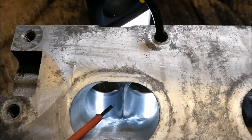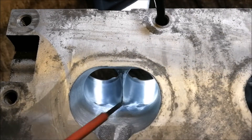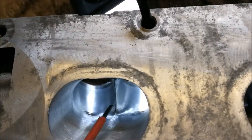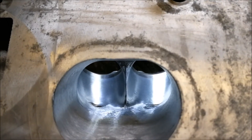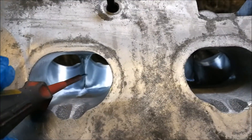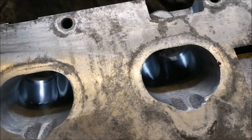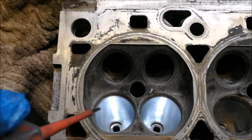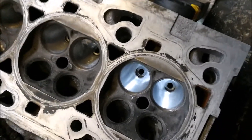We've just knife-edged the divider. I know there are varying opinions on that — some say don't knife edge. I've read things where people say airplane wings are not knife-edged at the front, but I think that comes from people who have no clue about aerodynamics and the difference between making an airplane take off and making a port on your cylinder head flow — completely different purposes. What's the real answer? I don't know. But many professionals I see go for a knife-edged divided port, and I kind of agree with them.